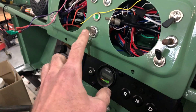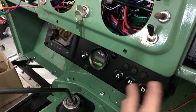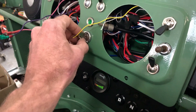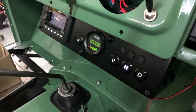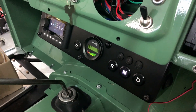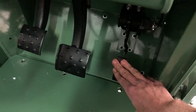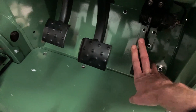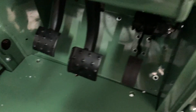The other thing to look out for is that this green light will turn on when all of that happens, and it will also kick into neutral. The computer will set neutral. With neutral set, there's no signal going to the motor as to which direction it should turn. So if I press the throttle, nothing happens — and importantly, that means if your foot was resting on the throttle when you turn the car on, it wouldn't go anywhere. But then if I press drive, I can press the throttle and the wheels spin.